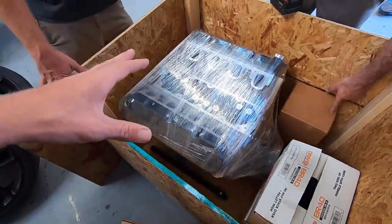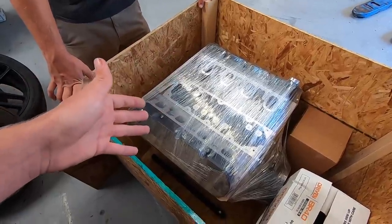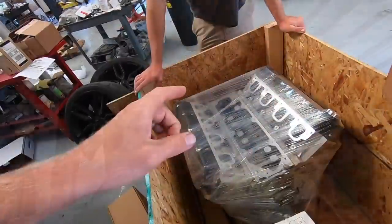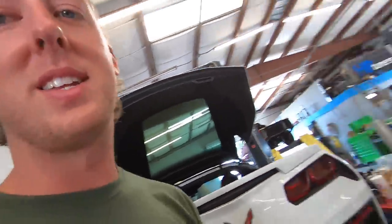So what we have in here is a 427. This is a re-sleeve engine, just like what Ruby has or Leroy's original engine — an LT1 aluminum block that they hone out and slide a sleeve into. You can watch the entire build on Texas Speed's website and YouTube channel. I originally thought they were just gonna take my LT1 heads and port them a little bit, but they put their LTX heads on it, which is like a super gnarly LT head — way more than I was expecting. These heads are insane.